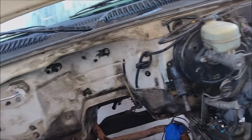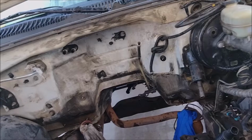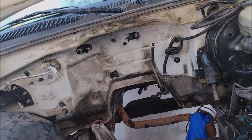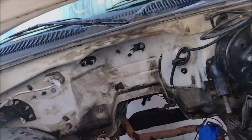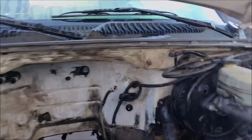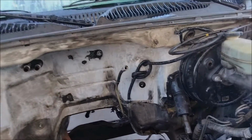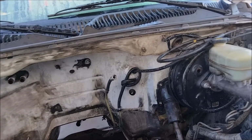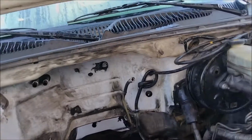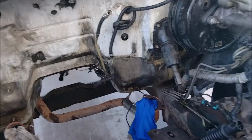The vent hose had, I don't know if I still have the picture on my phone, but the vent hose had like 9 different pieces with multiple clamps, for this like 1 foot section. So I converted it to return like it was supposed to be. I replaced the gas tank, which wasn't without a hole in it. So luckily on this one, on return, I can plug that into the 5.3.